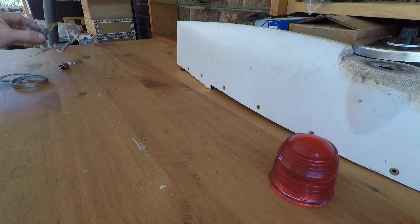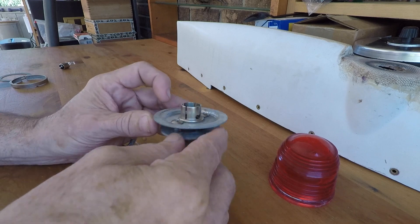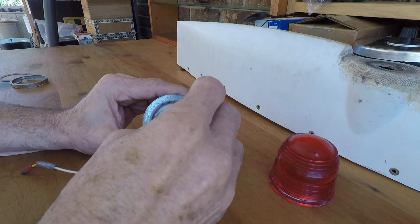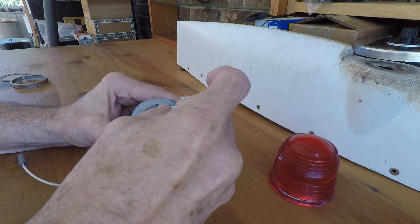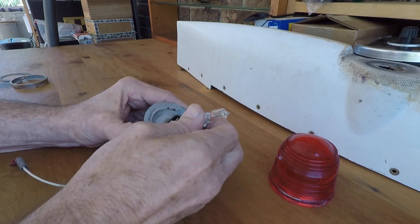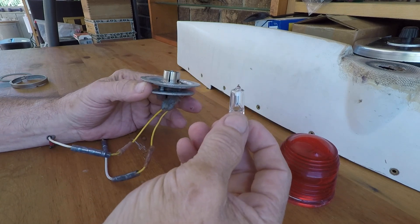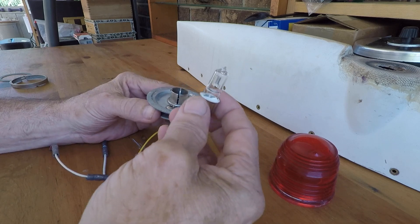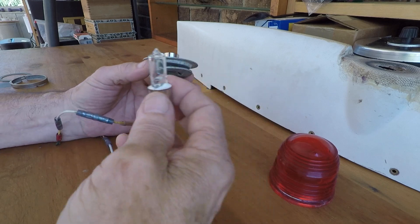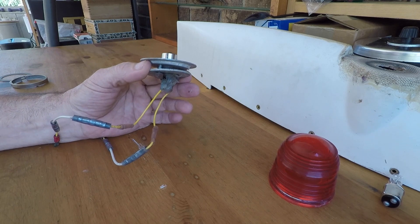Take the jelly jar and move it aside for a second. In the top of the rudder cap we have this fixture, and inside the fixture is a bulb — our flashing beacon bulb. If you go to Aircraft Spruce, this is a T14 bulb, rated for 14 volts and 125 watts. It's a fairly bright bulb that generates quite a bit of heat, which puts stress on the 10-amp circuit it's on, because the flasher itself draws about 11 amps under peak.